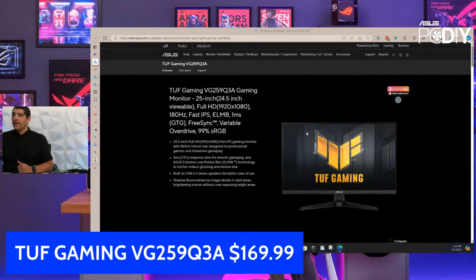So if we take a look at the specs here, this is going to be a 24.5-inch display, 1920 by 1080, 180 hertz, new modern fast IPS-based panel, supports our backlight strobing technology, that 1 millisecond gray to gray. Again, that's a peak measurement. The overall average response time will be higher. It does have FreeSync-based support, so VRR support, and it has variable overdrive. Variable overdrive is pretty rare to see within this price segment.